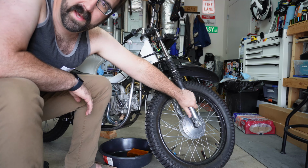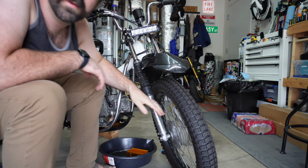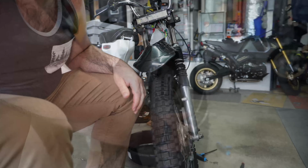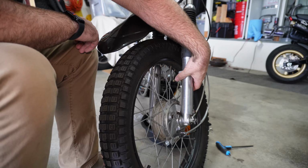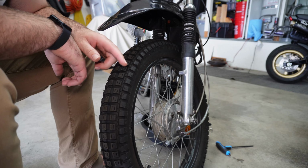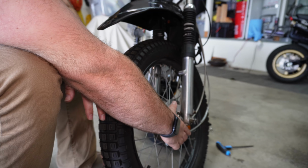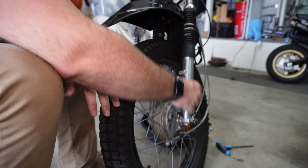With the 125 front end, this is actually a, you might be able to see it, you might not, a C100 brake hub, so original CT90 wheel. Let's put it over here. The CB125 has the brake stay on the opposite side of what the CT90 had. And so CT90 wheels you can flip around, and then I got a C100, I don't remember what year that was from, but a C100 brake drum and speedometer gear that's in there as well for it.